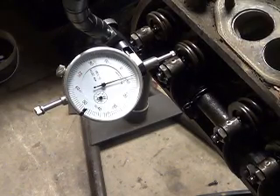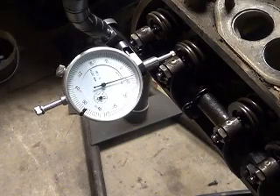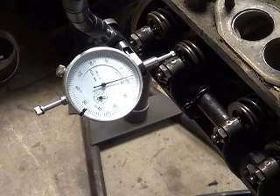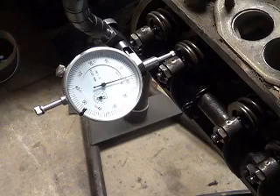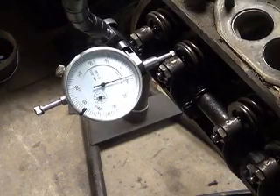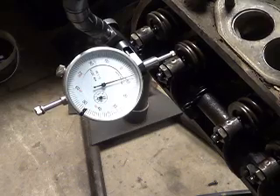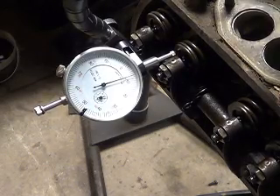So we've got: five, six, seven — four hundred and seven, add another six — four hundred and thirteen, plus approximately 6 thousandths for your valve lash. That would give you approximately 419 thousandths. The advertised spec on the chart — I'll have to go look — I think it was 420 thousandths on both, with a 1-to-1 ratio rocker.